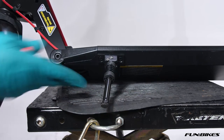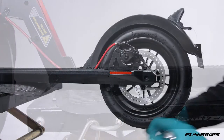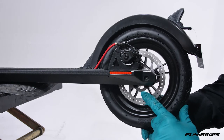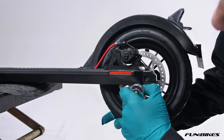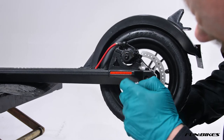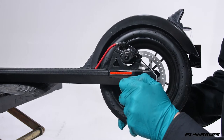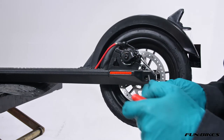We're now ready to make sure that the rear brake caliper and brake disc are tight on the scooter. Using a four Allen key, make sure that your brake disc is tight. Find the size of the brake disc — this is a 110 disc stamped on it — or use the directional arrow as a starting point, then work your way around each bolt, rotating the wheel until you get back to the point you started. Once you're happy they are tight, use a three Allen key to check the covers are tight on the rear of the scooter.